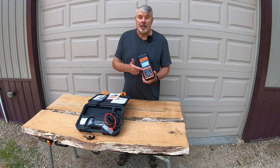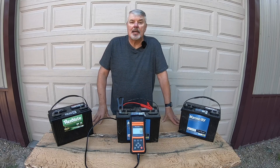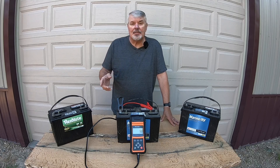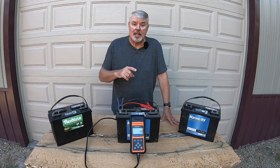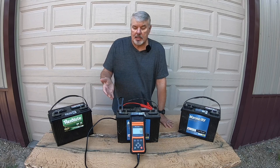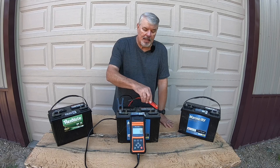Let's see how good this tester really is. These batteries here are dead — they've been sitting in my garage or pole building for the last couple of years on concrete, so I know they're pretty well drained out. You'll need a couple of bits of information because the meter will ask for cold cranking amps, which you can find on the tag on top of the battery, and whether it's a top post or side post. Even though the unit has an on-off button, the minute you put the clamp on, it automatically turns on.